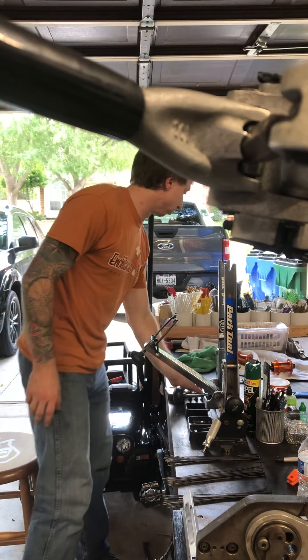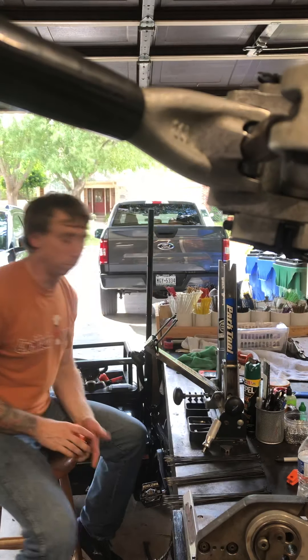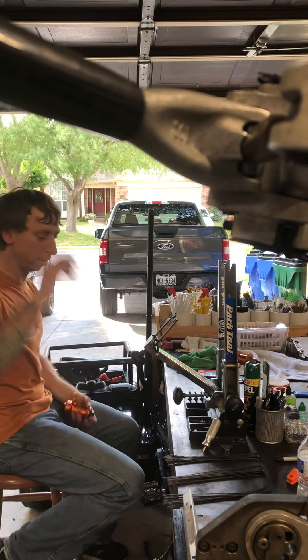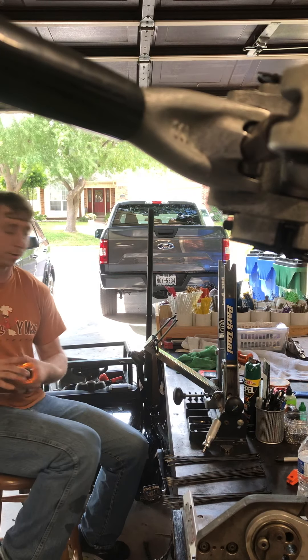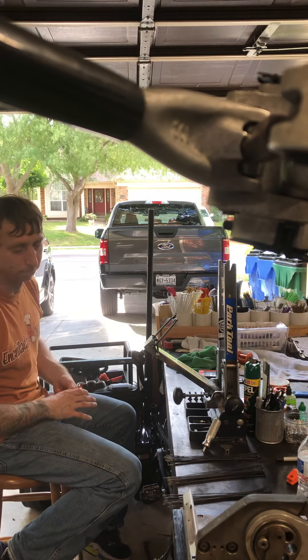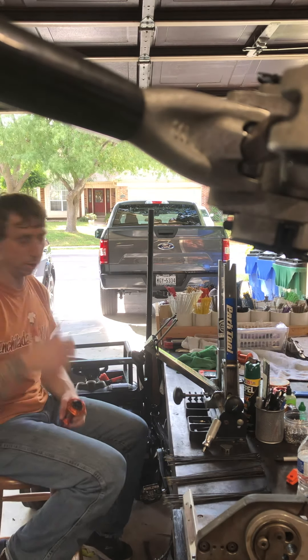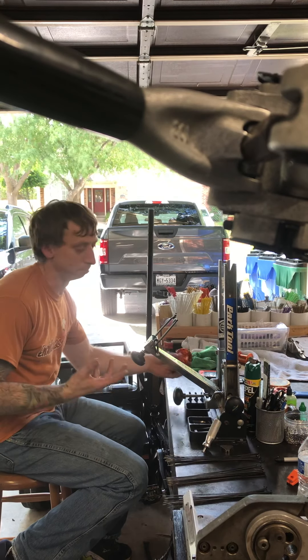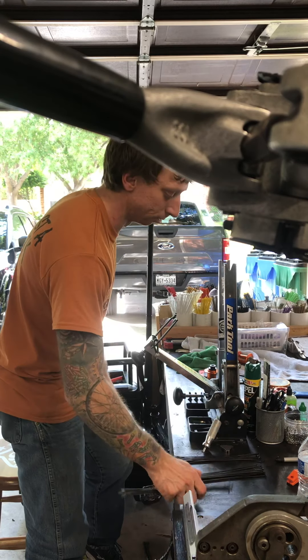The ERD of these wheels — starting with this front hub 110 — the ERD 591 is marked on the board for this brand. I always make sure the brand is correct and update the board, since sometimes brands get different rims that look the same but have a different ERD. I re-update the board accordingly, and 591 is still accurate there.